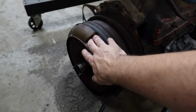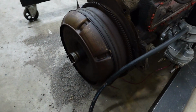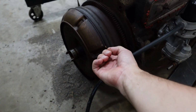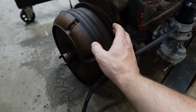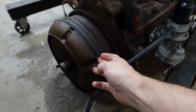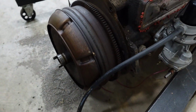This here is actually a cooling fan. And this rock, the reason why that brings up another thing is for all we know, some of the leaking, or maybe all the leaking, was actually coming from a hole in this torque converter. So when we get it unbolted from the flex plate here and take it off, we can inspect it, get that rock out, inspect it. There might even be a hole caused by that rock.